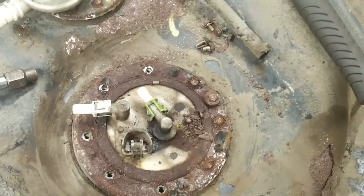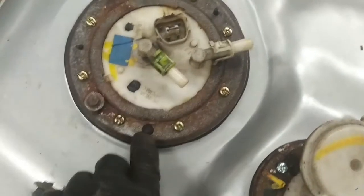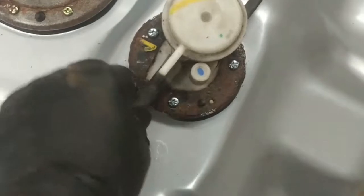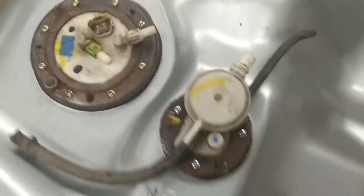We'll get this fuel pump out and transfer it over to the other tank. There's the original pump and retaining ring installed back into the new tank. This rubber locating dowel goes on this spot on the tank and the pump must be facing the correct orientation — there are little plastic ears that line it up. Use some silicone dielectric grease on the seals. I've wire-brushed them and I'm going to give them a coat of paint after connecting the lines to slow down any future rust. So we've got the tank back in, exhaust back up, spliced the exhaust with a piece of pipe, installed new brake lines, bled the brakes, and now I just need to put the fuel in the tank and we should be good to go.